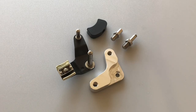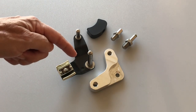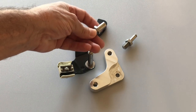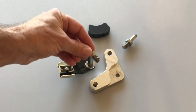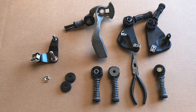This is Jim with Diesel Geek. I'm going to show you the ins and outs of assembling your side-to-side bracket for the Sigma shifter. This is the Sigma side-to-side bracket — it's the same for five-speed and six-speed. When you assemble it, you need to match the orientation. Take the slider pin, which is the larger diameter pin, and put it in the slider hole. The cable end pin goes in the other hole. The Sigma 6 uses the same side-to-side bracket as the Mark 4 five-speed — the holes are exactly the same, just make them match and everything will be fine.